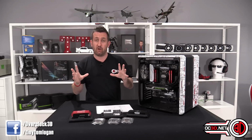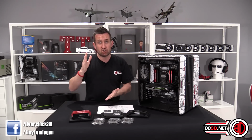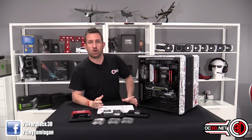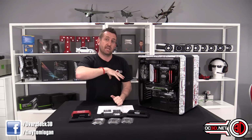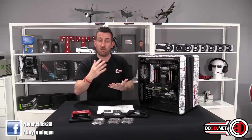Now, the motherboards, when they're left at stock, so when you go into the BIOS and it says auto volts, basically what auto means is it's not a set fixed value. And a lot of people come and ask for advice on the Overclock 3D forums, and they say, oh yeah, I've got a 4.4 gigahertz overclock and I'm at stock volts. Processor's amazing, I've got to be able to get 5. But what you actually need to do is open CPU-Z up and see what your voltage actually is, because auto means that the motherboard and the BIOS can actually overvolt it for you.